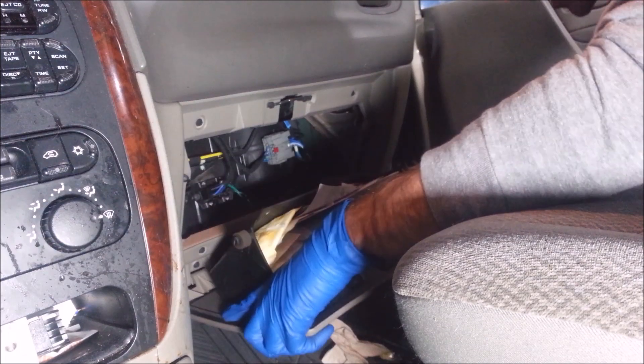The reason why I took this glove box off is because I want to check this resistor. I got this test light grounded, and the power and ground — they both got power. So I got power running through this blower motor but nothing's happening. I can unplug this pin right here, take my power probe, stab this one in the green and stab this one in the black. This induces voltage into it. You can see right now the ground light is on, so that means there's actually continuity running in and out of this blower motor, and I can power it up and it's working.